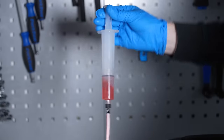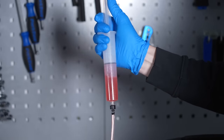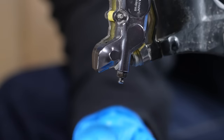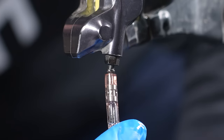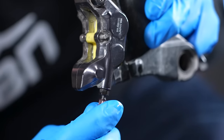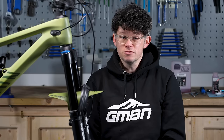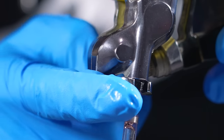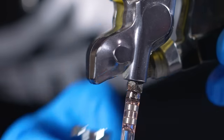Fill the syringe two-thirds full. Next, we're going to attach the syringe on the bottom — first we've got to remove a little rubber guard. We'll need a 7mm wrench to open it up once the syringe is on, and we'll need to prep the syringe. Once the syringe is on, open up that valve and then start the bleed process.